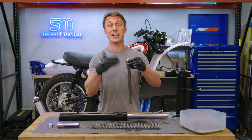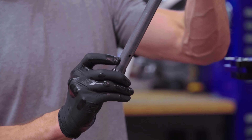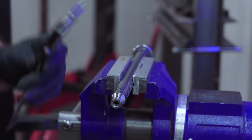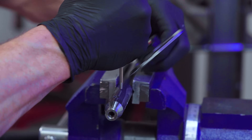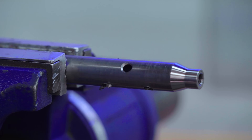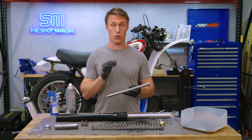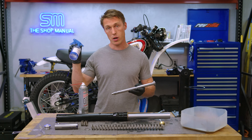The gold valve is going to sit on top of the damper rod, and since it takes over compression damping duties, we need to disable the compression damping holes in the damper rod by drilling them out. Enlarge them with a quarter-inch drill and add more holes so there's no restriction through the damper rod itself. The holes need to be drilled at 10-millimeter increments, perpendicular to the other sets, for a total of six holes. Chamfer and deburr the holes with dedicated tools, a small file, or sandpaper, then clean out all the swarf and grit — Maximus Suspension Clean is ideal, but carb cleaner or isopropyl alcohol also works.